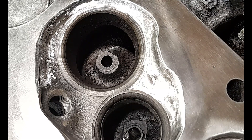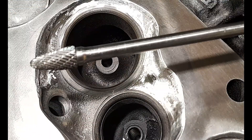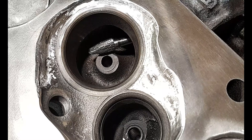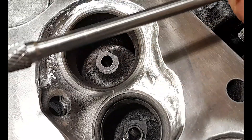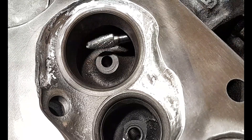I'm going to show you guys how I go about thinning down my intake valve guide bosses — these big guys here. What I'm using is my pneumatic die grinder, because I need the long shank carbide for this one. It's a tapered carbide burr, and I need the long shank because I can't use it in my electric die grinder — it has too much run out and ends up bending the entire shank. At 30,000 RPM, you can't put long shanks in high RPM electric die grinders. But it works perfectly fine in my pneumatic, lower-speed die grinder.